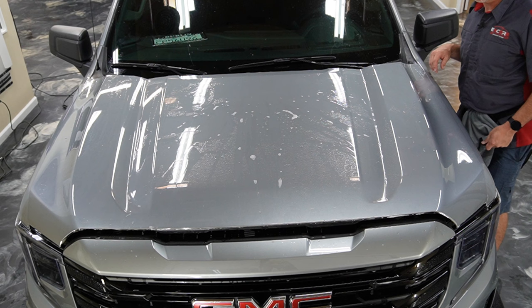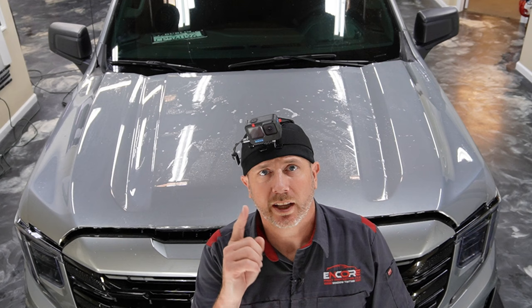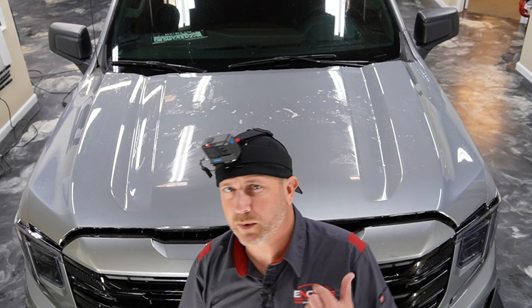Awesome — I appreciate you taking a look. If you found anything useful please like and subscribe and I'll see you on the next one. One more tip: if you're a little bit newer at installing paint protection film, it's also a good idea at this point to go ahead and dry this hood off — wipe it down with your towel, dry that off, and be real gentle while you're doing it. You don't want to rub the material, you just want to wipe the moisture off, and what that's going to do is allow you to be able to see the hood better so you'll be able to tell if you left any water pockets behind.